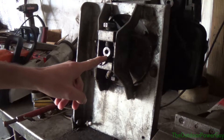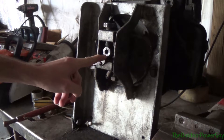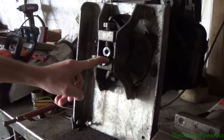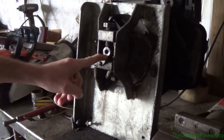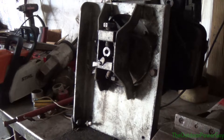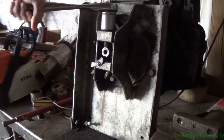This little needle here - there's supposed to be a gauge over here that goes up and down, and when it's right in the center is when it's straight. I need to get some replacement parts for it. When it's weighed down like this it means it's bent. I could sacrifice one of my sockets and risk busting them, but I'm not. I just do it this way because this isn't going to mar up the crankshaft surface. So we're going to take the pressure off and see.